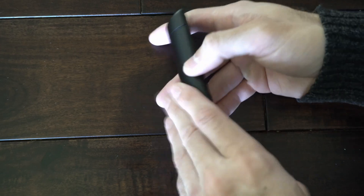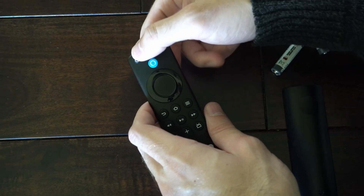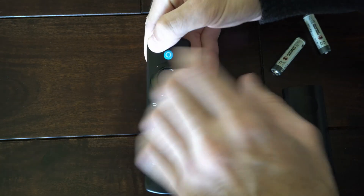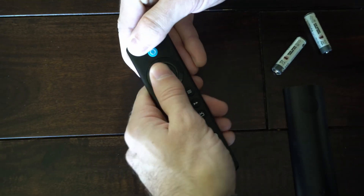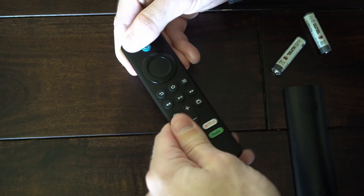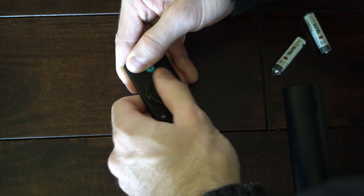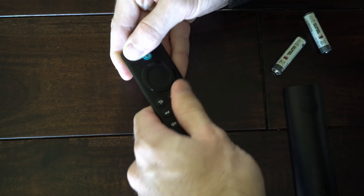What we want to do first is take out the batteries on the remote. Hold down the power button for at least one minute and press every button on the remote, trying to dislodge any button that may be sticking in. Go up and down the remote, pressing every button at least three or four times. Then you can let go of the power button.